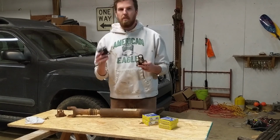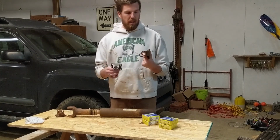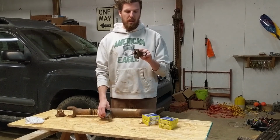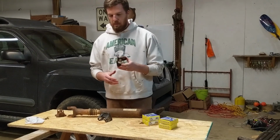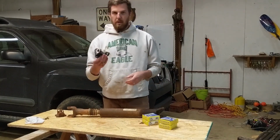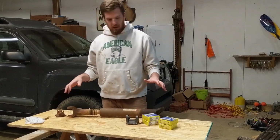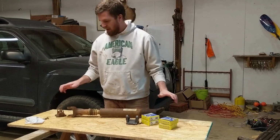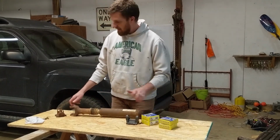So I got a new one. Hopefully that'll make it easier to get the bolts back on. And also I nicked this with a grinder when I had to cut the bolts off. So it's probably not a big deal, but I figured this is cheaper than blowing something up. So let's get started putting the new U-joints back into the front drive shaft here.